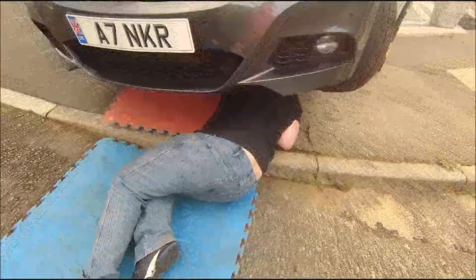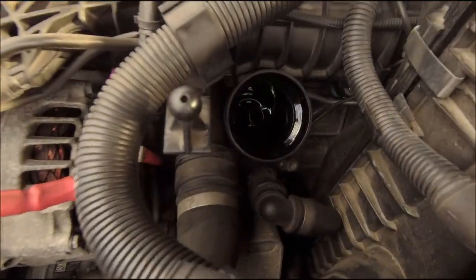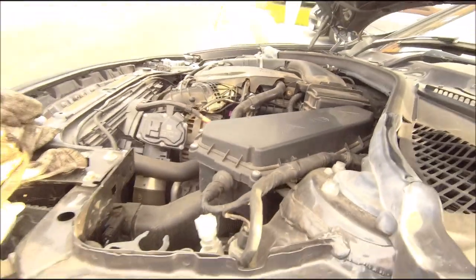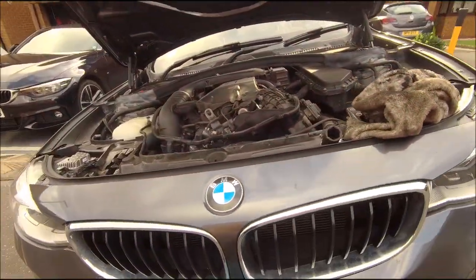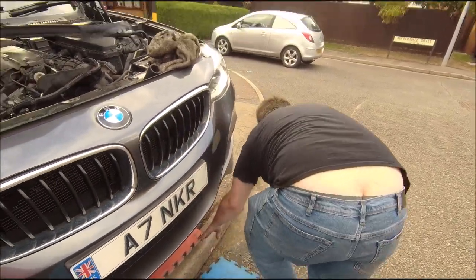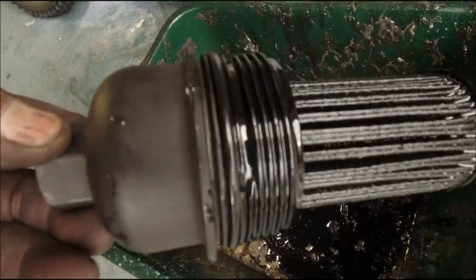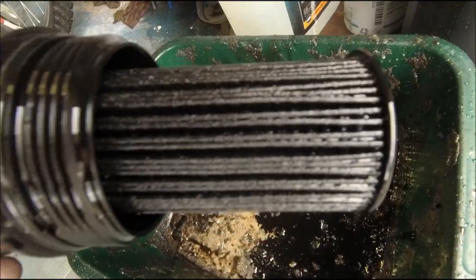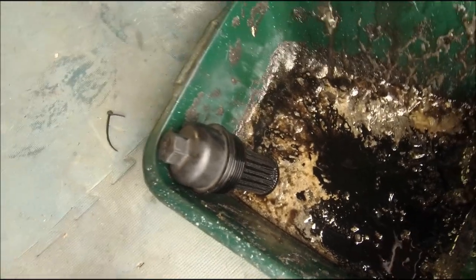He's under the car - the oil filter is out. We looked online for the socket size and tried 32mm as suggested, then tried every size, but found that 27mm is the magic number. So 27mm is on there, it unscrews and there's your filter. Simple - that's the easiest bit done, we'll leave that draining.